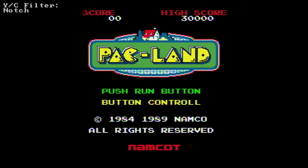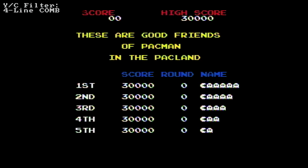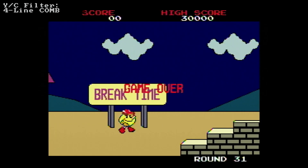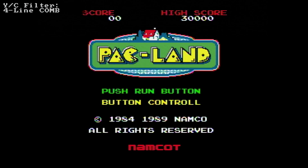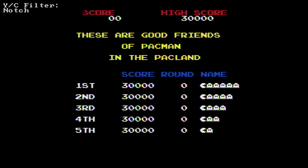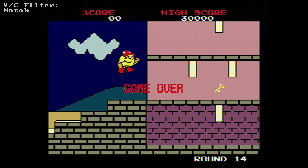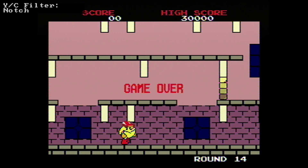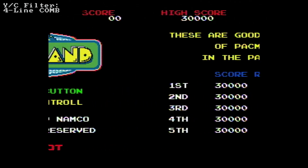So if I go into four line comb - okay so that's notch, that's four line comb. You can see on the writing there the writing becomes noticeably clearer. So notch, four line comb. Now as the writing moves on notch you get a lot of blockiness around the edge - you can see there on the word 'break time'. So notch is extreme blockiness on the edges of pixels. Going to four line comb now - let's look at the edges of the writing when it scrolls. You still get blockiness but it's not as bad.